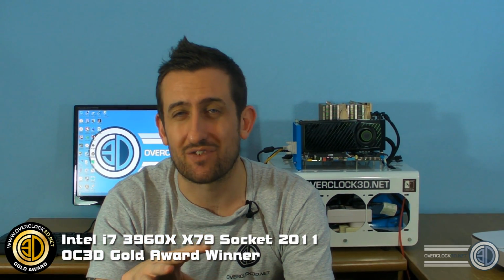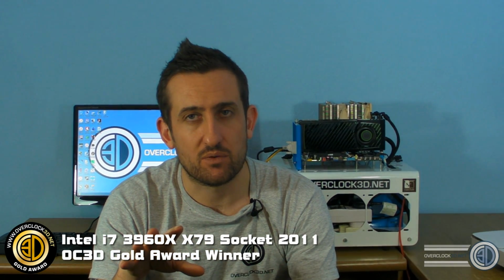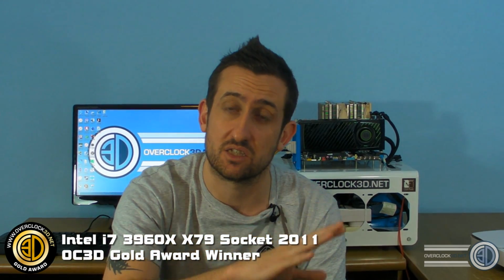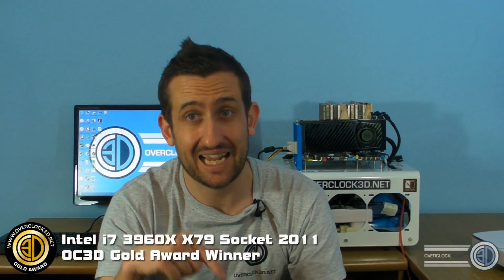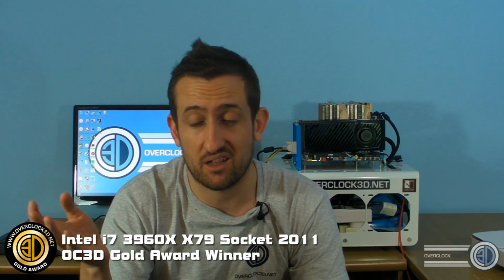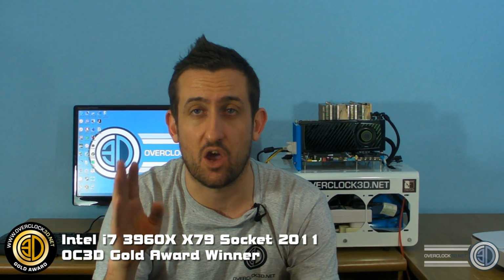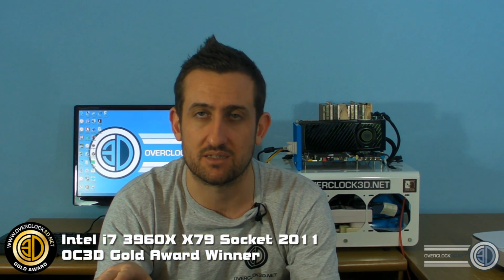I've got to admit, the sample that I've got didn't overclock as well as I was expecting, but then again, I've not gone crazy with the volts this time, and I have heard that there are some amazing other processors out there that have gone to different websites and vendors. There are just some bonkers ones up there. I sadly didn't get mine over 5, but I've seen them well over 5 with decent volts, and I think it was the Silicon Lottery. I've just not won it this time, in that I have seen a 3960X at 5 gigahertz dead at 1.37, say 1.38 volts, 100% stable.